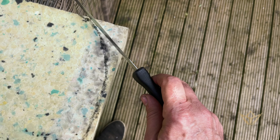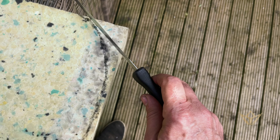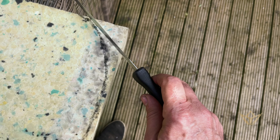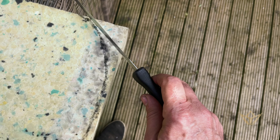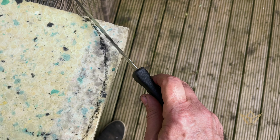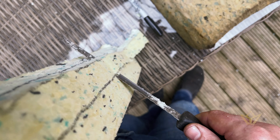If you're doing an authentic restoration, this is why it's so important to look properly at the original, or what's left of it. You see these screws here — this one snapped off. I'm not quite sure what they were because there's no hole going into the frame. They register on the top here. I'm assuming it's a kind of height adjuster for the front of the seat, to raise it up or down. Now we just need to punch the holes for the rivets for the upholstery work. It's quite a lot more work than I thought, but very satisfying.